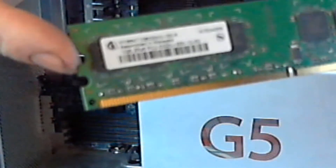Look if you can see that better. There you go, make sure you're mounted — just static. Pull it out, there you go — that's the memory that's in it. 1 gig. I'll put that to one side, I'll take out the top one, and there's the other 1 gig stick. And I'll install the Crucial memory 2 gig sticks in here.